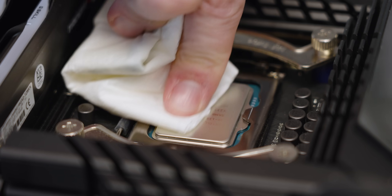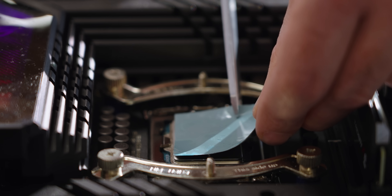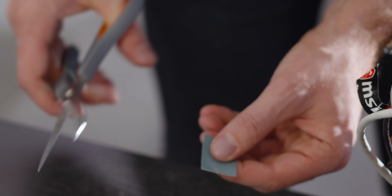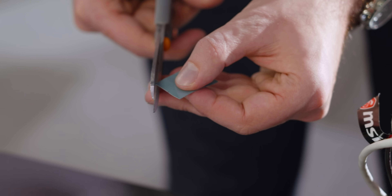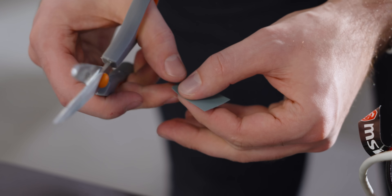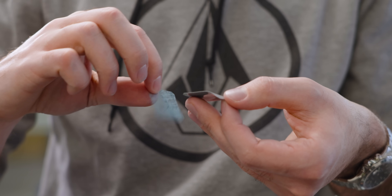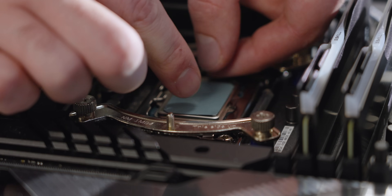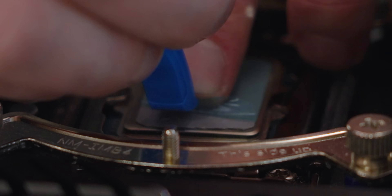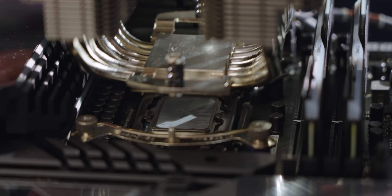Maybe you could keep it next to your photo film — it helps make the material a little bit more workable. The first thing you'll need to do is clean both the core or heat spreader of your processor and your cooler. Then, after measuring the approximate dimensions, cut up your pad with a pair of scissors. You don't have to get this exactly right because PTM7950 is non-conductive and shouldn't damage anything if it seeps over the edge. Next, peel one side of the pad — we recommend sticking it to the processor rather than to your cooler. Apply pressure evenly over the pad, then peel the other side with needle nose pliers or tweezers. Finally, install your cooler.